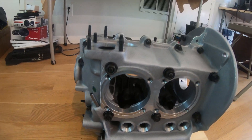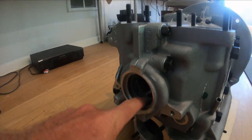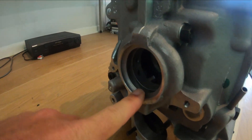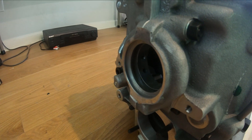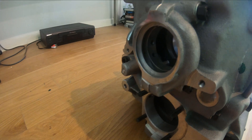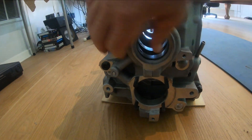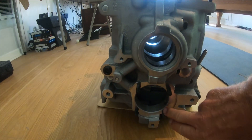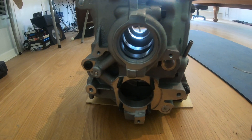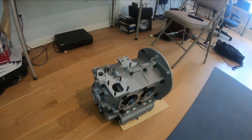The other thing this one had — I didn't actually ask for it, but cases were hard to find — is it's cut for the sand seal, so I guess that's what this is, and I'll have to buy the pulley that has the sand seal. It also looks like we have the full flow oil here, which I have the matching pump for, so I will crack this open and get it up on my stand.